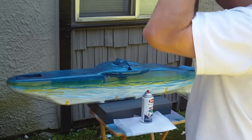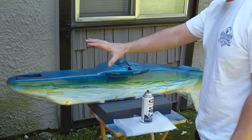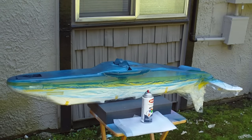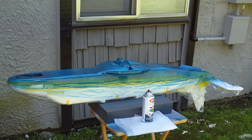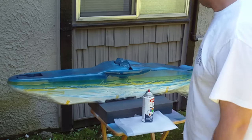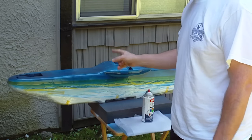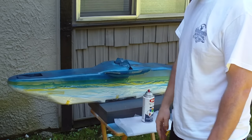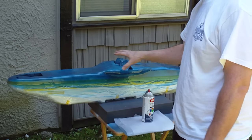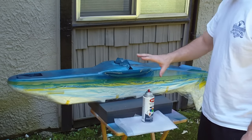I like that — that's a good first coat. I'll wait, come in with a second coat, third coat. By the third coat, it will all be one steady navy blue and she'll look beautiful. That's how you do it. After the three coats are on and once it's dried, I'll go ahead and pull very carefully — pull all the masking tape off, all the saran wrap, pull it all off very carefully after it's dried. If you try and do this when it's still wet, you run the risk of touching the paint, or having the saran wrap blow back in the wind and damage the paint. So you really want to give everything time to dry before you mess with it.